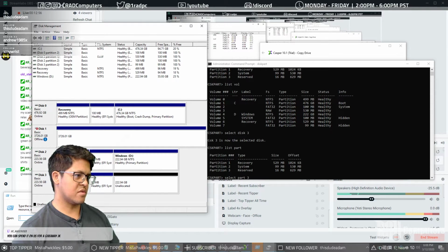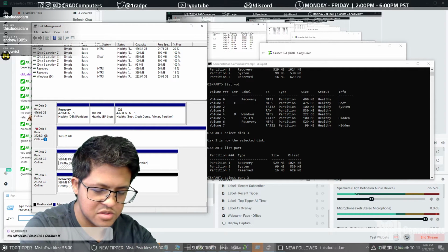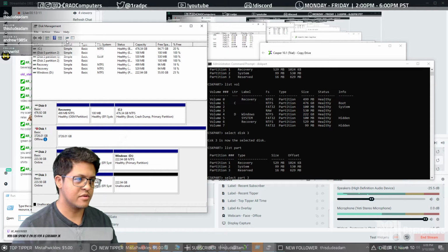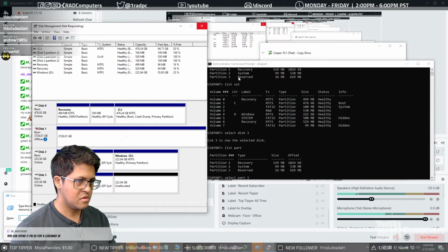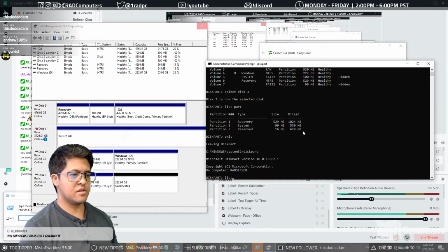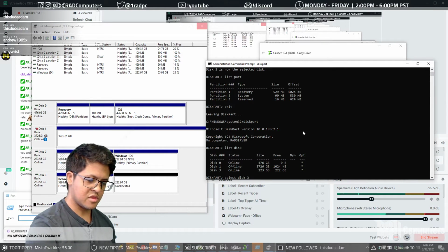Okay, so disk 2 has a raw partition. It says OEM partition, but it also says raw at the beginning, which is really interesting. So to prevent us from formatting his drive, let's just do the smart thing and unplug it. Okay. We'll exit the diskpart, and then we'll go back into it. List the disks. Alright, so disk 3 is the one we want to blow out.